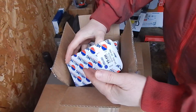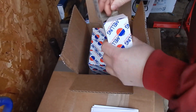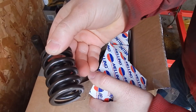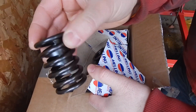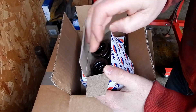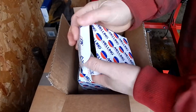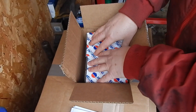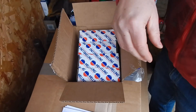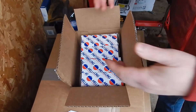Here's a box that's part of the plan — this came from Rock Auto. We're gonna take the heads off and just lap the valves, but these are 68 GTX 440 Magnum valve spring replacements with the damper inside. They're 105-pound pressure springs with the valve closed on the seat. I got this entire set shipped to my door for $68. By the way, the price of the 440 was $400, plus $100 for the transmission behind it.